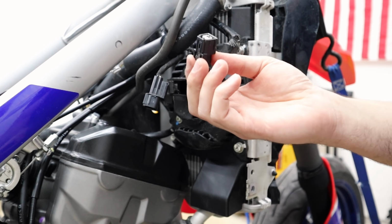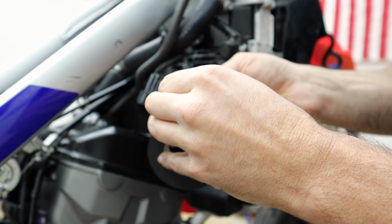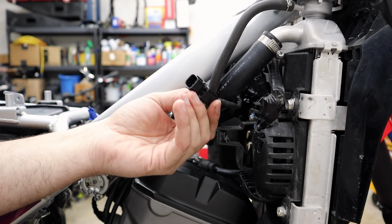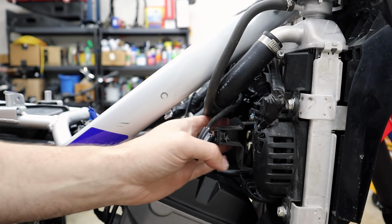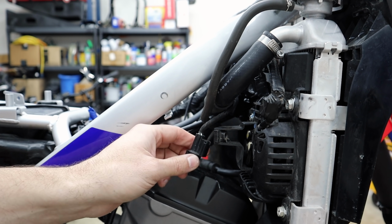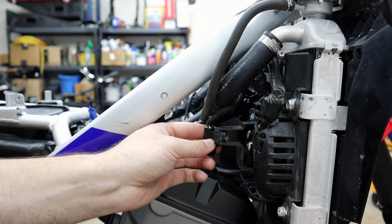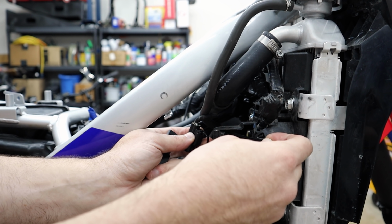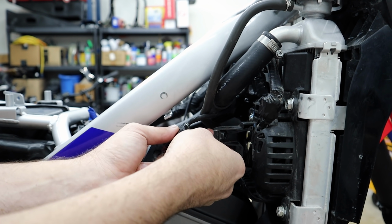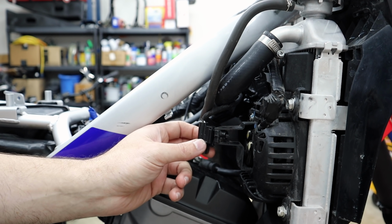Just like the other side, we need to pin this connector off. Another piece of safety wire. Now I'm left with this connection right here, which goes to my O2 sensor, and this was sitting across a bracket that was holding the solenoid. I guess I could take the solenoid out and put the whole bracket up just to re-get the thing that clips in and holds this. Or, this is where one of the bolts went, and we'll just put another zip tie through here. Kind of put it through our loop. This connector is sitting roughly where it was sitting before.